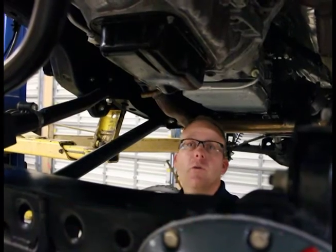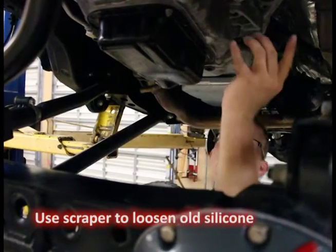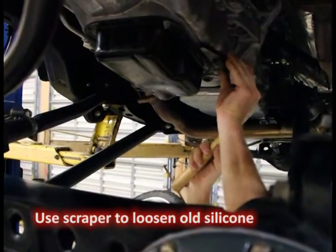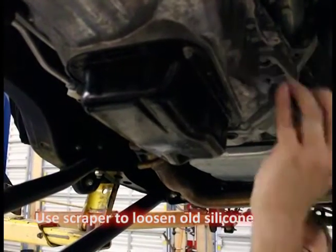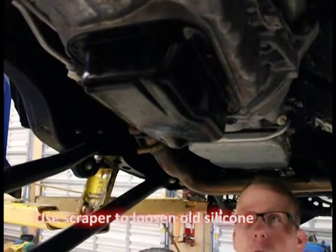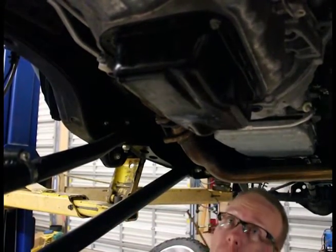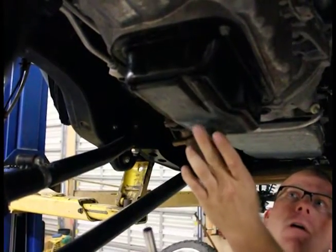It's difficult. The tool I use — and I think you'll have good success with — is just a scraper. Put the scraper in there between the two, then use your hammer, get it in there, then turn it and cut along like this, it cuts the sealant and you take it back out and do it again. That way you're not deforming the pan, you're not gouging anything — just work your way around until you've got it pretty close. When it finally starts popping down, it's going to be sitting on those studs.